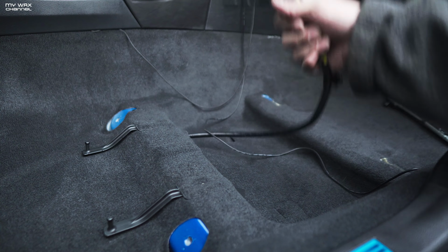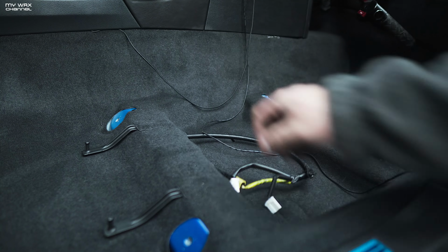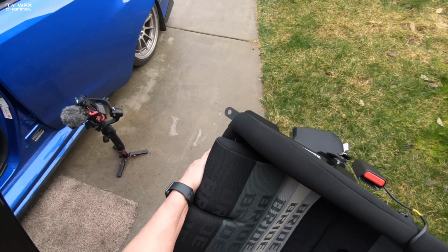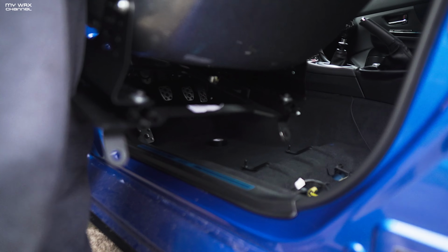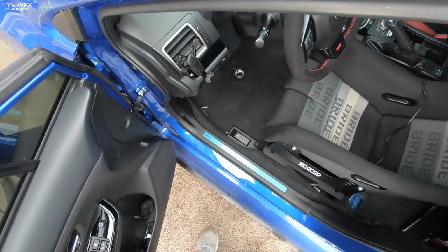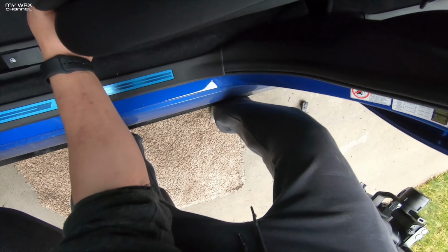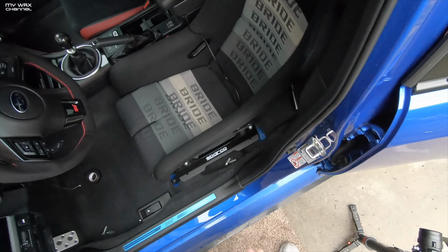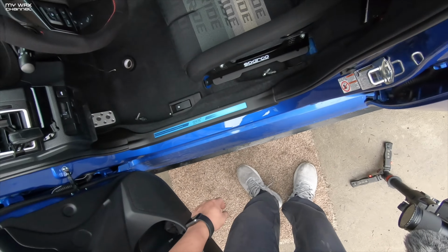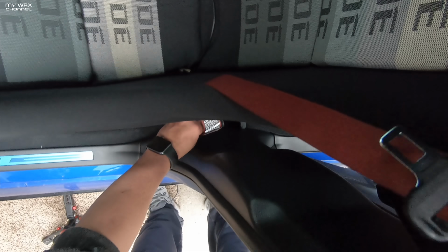They're off. This is there, that should be good. Seat belt. All right, now we can install the seat. Watch the panels. Okay. It's almost in there. All right, I'm gonna put one bolt in there. I'm gonna turn on the ignition, make sure I don't have an airbag light. So before we do that, let me loop this through. There we go. So we can bolt that in.